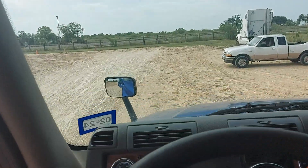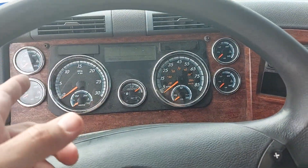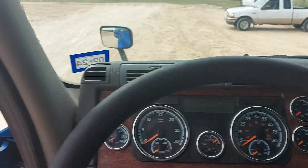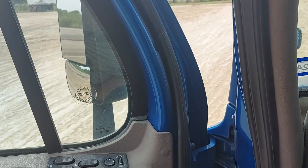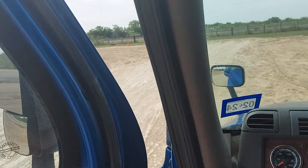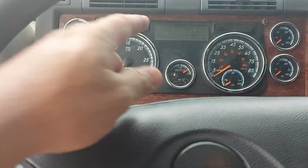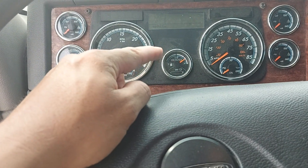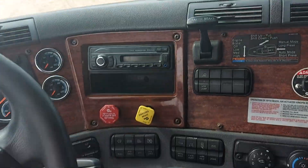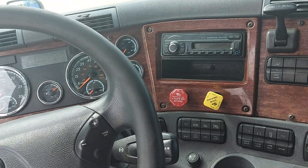I should try and get the inspector to do the lights before I get in outside — say, 'Hey, can you check my lights?' I'll turn on my headlights, do my high beams, left turn, right turn, four ways, and hopefully they'll go to the back of the truck. Ask them: left, right, parking, brake lights, four ways. Then check the indicators on the dash — left, right, four ways, and my high beam indicator.